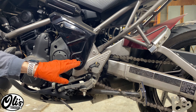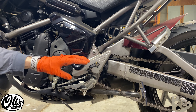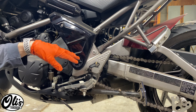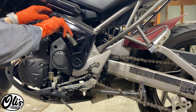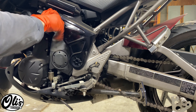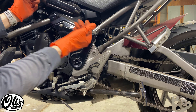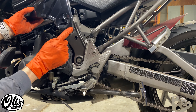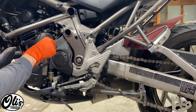I'm replacing the front sprocket, and getting that nut loose is challenging if you don't have the rear wheel still installed because what we're going to do is use the rear wheel brake to hold everything from spinning. So to get to that front sprocket nut, first take off this cover — just one little screw right here. With the screw loose there are two little pins; just carefully pull these straight back and then pull it up and out. That releases the little tab that goes in there. Now we're going to remove this front sprocket cover.